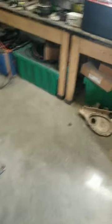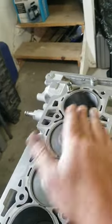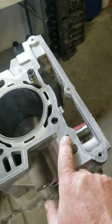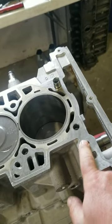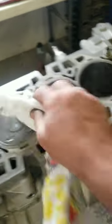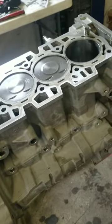On the last video I took a block sander to clean up the block and it did work. But on that engine I rolled an edge and had oil leaking from here to here — something weird like that. So I had to go back and fix that. A sander's probably not a good idea unless you're really careful and know what you're doing — it'll probably cause more damage than good.